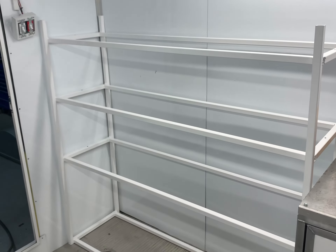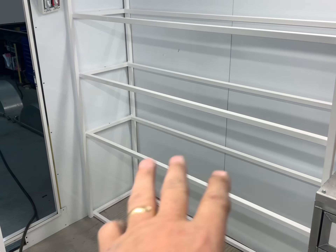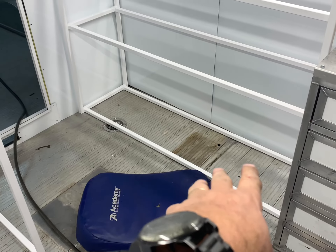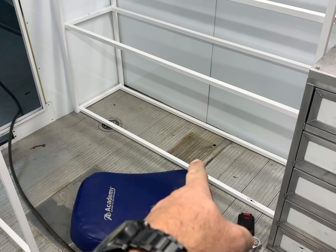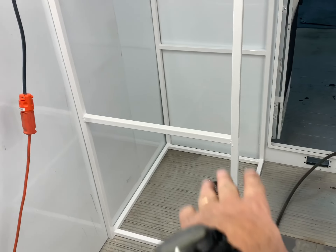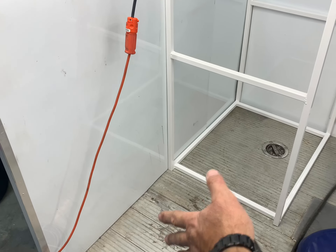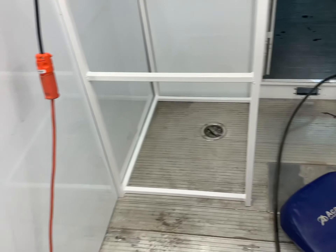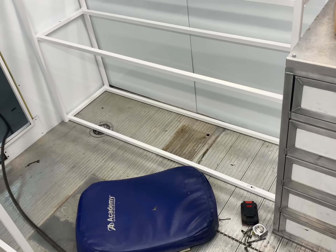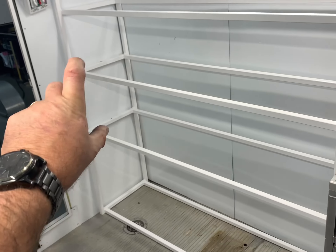This is what the shelves look like finished, and I've already cut the plywood. We went to Home Depot this morning, picked up plywood and got it cut to fit the top three shelves. We're gonna leave the bottom open partially — we're gonna put fuel jugs down there. On this side it's gonna be where the tires go, kind of a stand-up tire rack. We're gonna sheet this out with aluminum, back the air compressor in there. First item of business: get this thing bolted down and in position, then put the shelves in, and then put a lip of aluminum around each one.